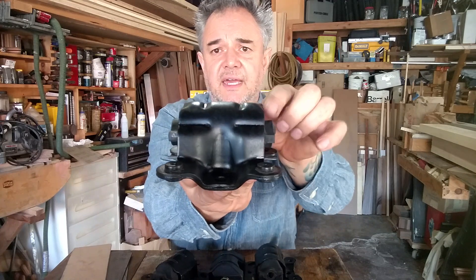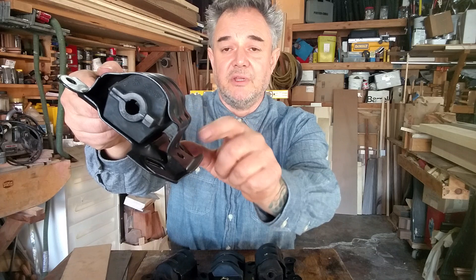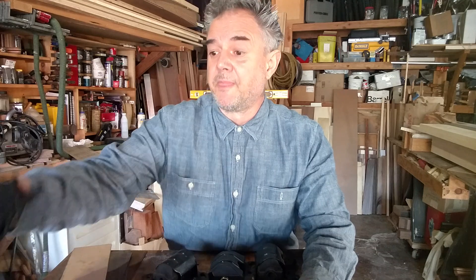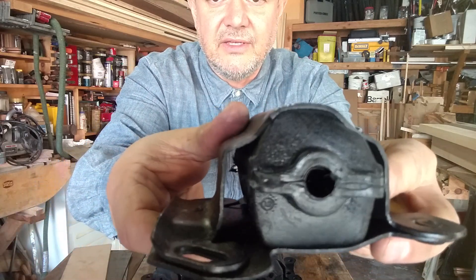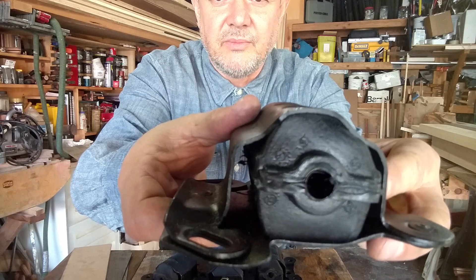Here's another Napa one — you can see the difference: thinner cage, smaller bushing, more of a garbage rubber. It's also knocked over on the ends, so if you see that, you know you don't have an original. And here's what I think is an AutoZone one — look at that cage, look how thin it is. You put this in your truck and the first thing that'll happen is the weight of your motor will bend that cage. Total garbage — can't believe they even sell it. Here's another Napa: again a skinny cage, but a decent bushing on this one. You can tell because the bushing has features cast into it, which usually denotes a better quality product.